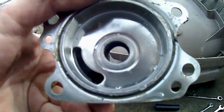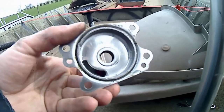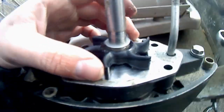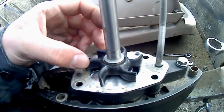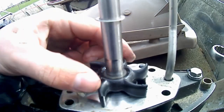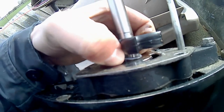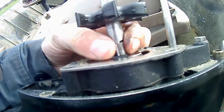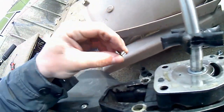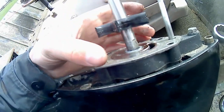You want to inspect this for any gouges or any parts where it looks like something might have melted. This one looks fine. The impeller is a little bit bent but not bad — we're going to replace it anyway since we got to this point. There's a plastic washer that goes on top of the impeller. Lift up the water pump impeller — sometimes this can be tough to get. This is the key way; you do not want to lose it and definitely don't want to drop it down any of those holes. We'll set it aside. We're not replacing the whole water pump housing, just the impeller, so we're going to leave the rest of it on.